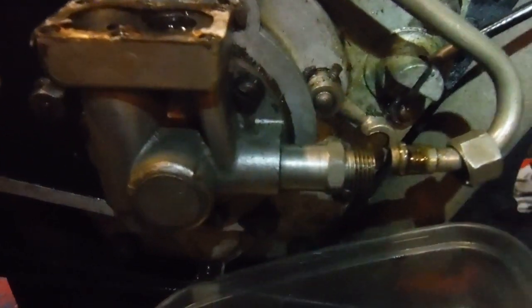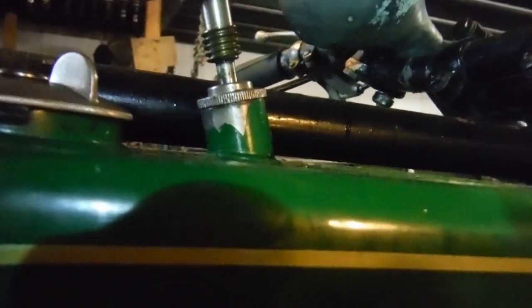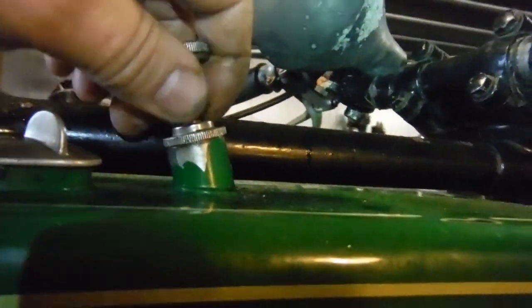I've got oil in the oil compartment of the tank which holds the fuel and the oil. I'm going to disconnect the pipe feeding the mechanical oil pump. There's also a hand oil pump for priming the crankcase and to give a couple of extra shots of oil if you're laboring hard up a hill — you can unscrew that and give a couple of pumps. I'm just going to open the tap now — straight away we've got oil there, so I'll connect that up.